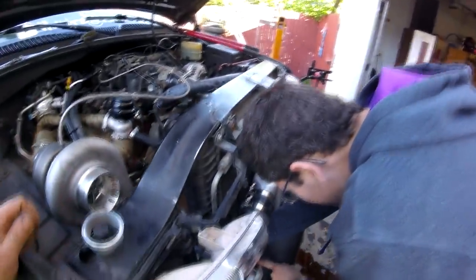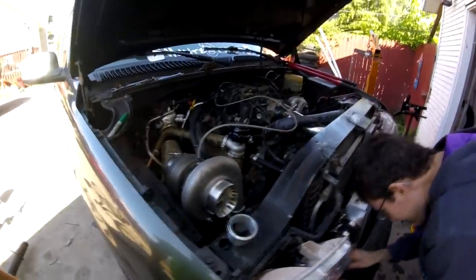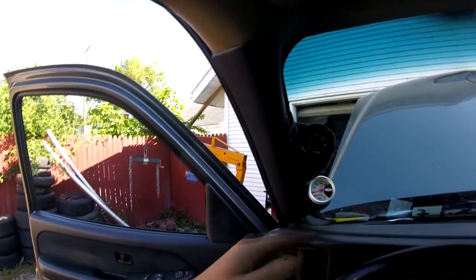I figured out the headlight mounting with a zip tie. I also put some gauges in the truck — a wideband and a boost gauge — and I put a Honda Civic gauge pillar in it. It doesn't fit the greatest but it's good enough. I got a Harbor Freight boost gauge and an AEM wideband like I always run. I also installed TR6 spark plugs — just a step colder heat range — and gapped them down to 20 thousandths.